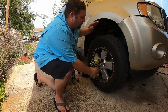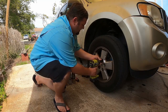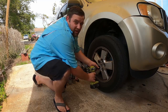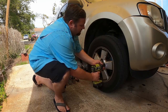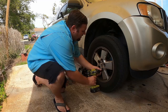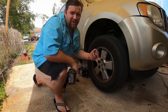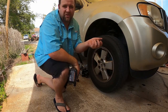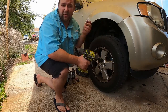The next thing we need to do is remove the tire from the vehicle so we can access the brakes. Ford's swollen lug nuts — we have these stupid tin caps on top of them that swell and stick inside your socket. I am using a 19mm socket. On modern vehicles they are 19mm; they used to be 3/4 inch, but that was before we switched to metric. There is a minuscule but real difference between 3/4 and 19mm.